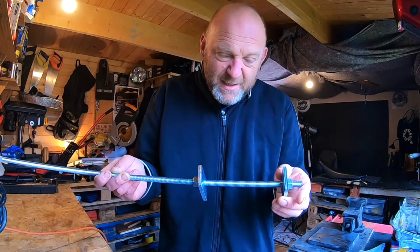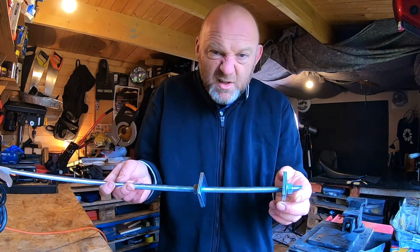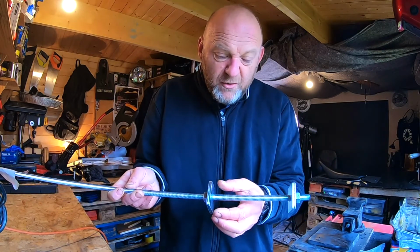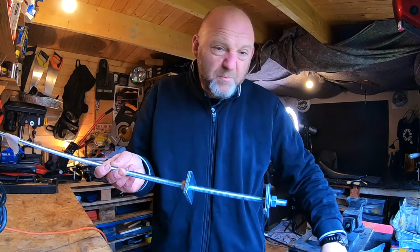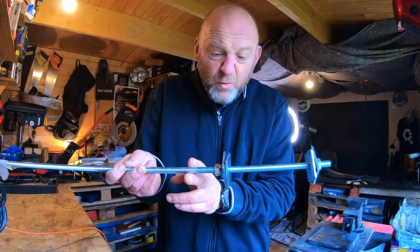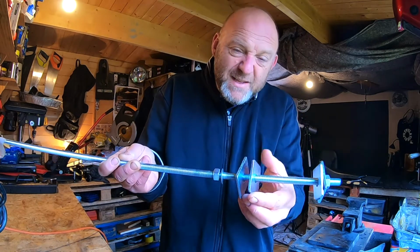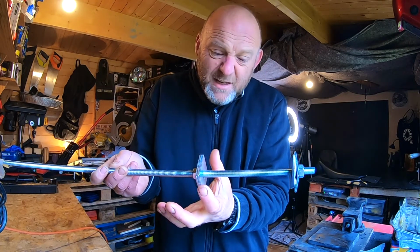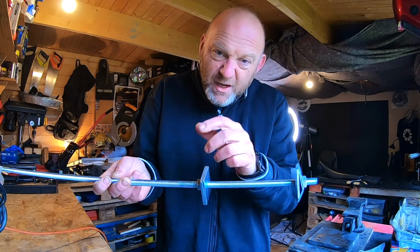Right, so let's get back to this bushing or bearing install, let's say on a swing arm, but you could apply this to lots of other things, let's say wheels, or headstock bearings, this kind of thing. So a cheap alternative: this contraption cost me less than a tenner. I've got lots of nuts, lots of big washers, lots of smaller washers. Get a threaded bar, cut it to the length you want, wind on a nut one side, then a smaller washer, then a couple of these big facing plate washers. I got all this from a DIY shop. The bigger the better, and the thicker the better. Double them up, triple them up, because these might bend as you're tightening everything up.